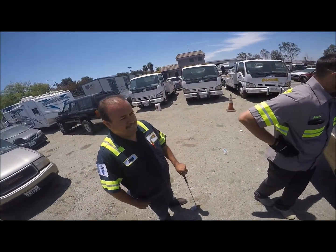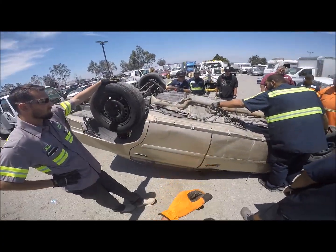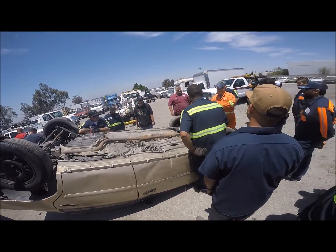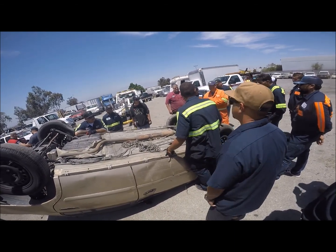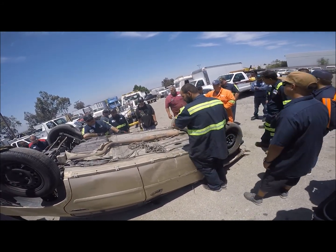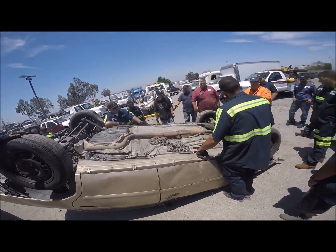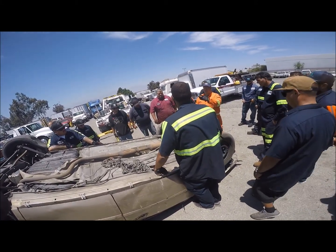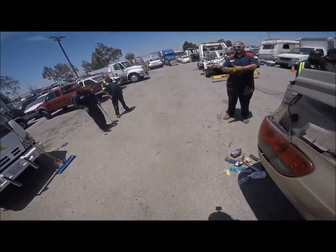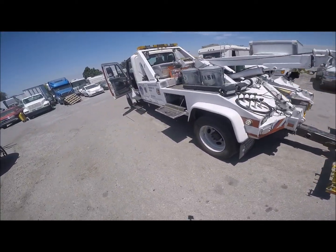If you go down an embankment, you're 100 feet down, and you hook up your chains to it. You hook one side of the chain over one side of the car, you hook the other part of the chain to the other side of the car, and then you hook into the ring in the middle, and you start to pull it. If one side disconnects, what's going to happen? The car's got to swing to the other side, because you've got a second leg on the other side, a separate bridle. But if you have a straight piece of chain and you hook off both sides and you're just hooked into the middle of the chain, now if one side fails, it's going to feed through the hook and the car's going back down the embankment. So if you get it 75 feet up the embankment and the chain comes disconnected, it's going all the way back down, and you've got to start over and do it again. But with this kind of recovery chain, if one side disconnects, you still have another chain connected.